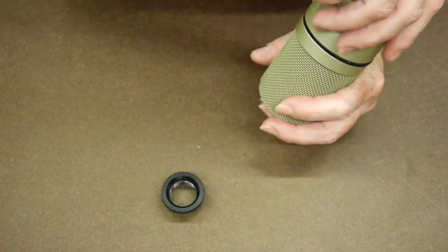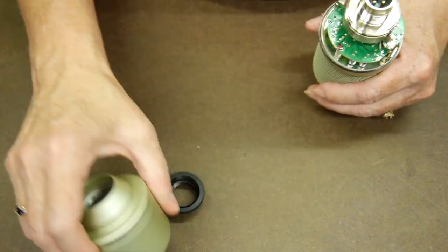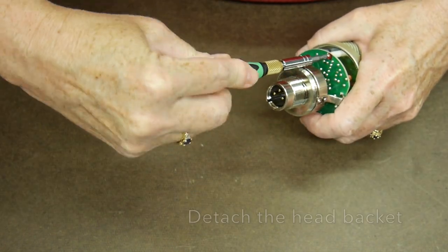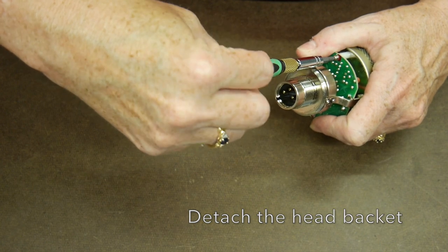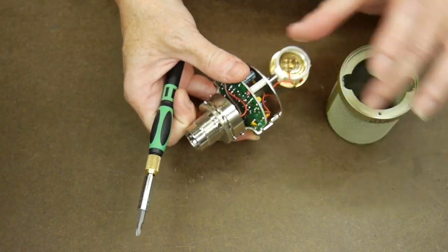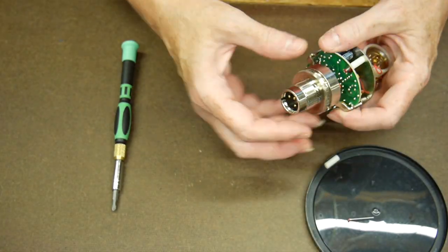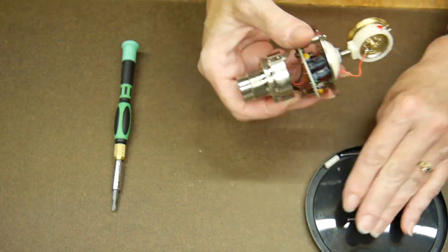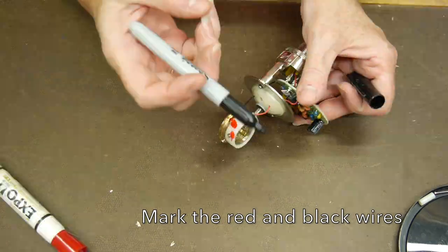Let's see how she does. To disassemble the microphone, you remove the screw ring on the bottom and then the main body comes apart. Next, we're going to take out the two screws that hold in the head basket. Chris doesn't have a lot of experience but she's still pretty handy. Next we want to remove the little spacers so we can slide the PCB out.